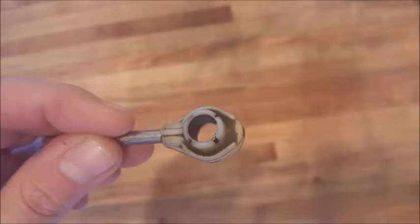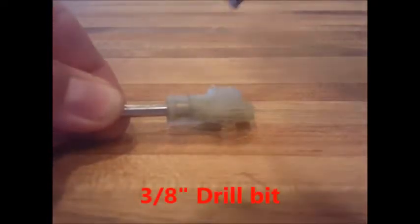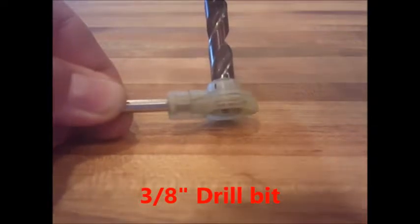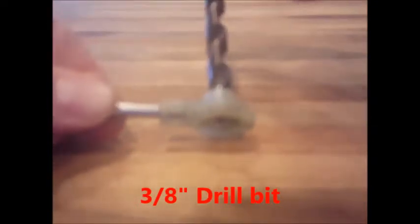If when you're drilling out with the 11/32" drill bit it begins to chunk, or it comes out in several pieces, or falls apart, or comes out entirely — rather than using the black bushing, you will use the green bushing. To prepare for the green bushing, just drill out using a 3/8" drill bit, just the top of the cable end.